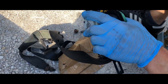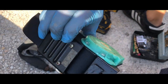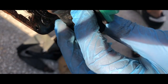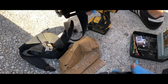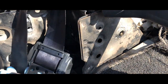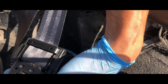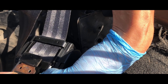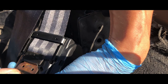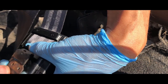I'm using a 15. It should come off pretty soon — there we go. I just banged it a couple times and got the rivets out. See the rivets right there — these two. Now you can maneuver this. Now we're going to reuse this. Let's see if we can mount the new seat belt to this. Let's see if any of these holes line up. Pretty close — this actually lines up pretty well right there. I think what we'll do is use these pre-existing holes and put some screws right there.